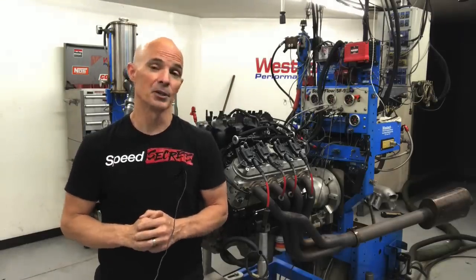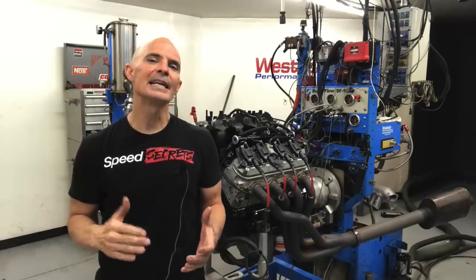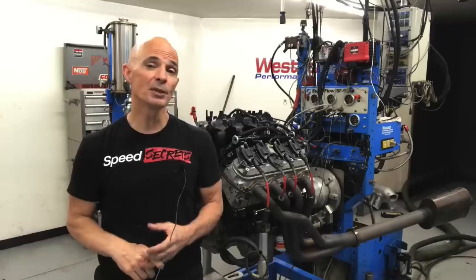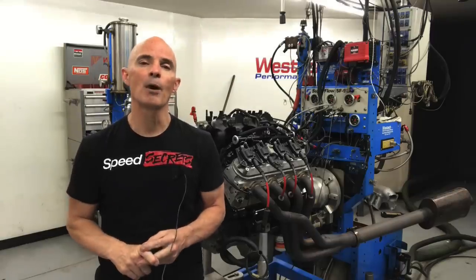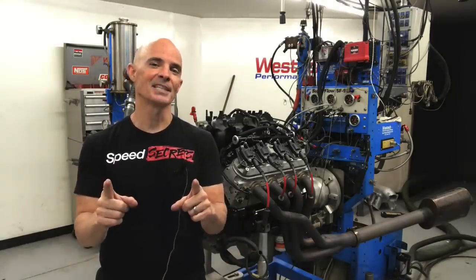In my opinion, if you got a street car, even a turbo 4.8 liter, I'd pick a smaller Stage 1 type cam. And the reason for that is a Stage 1 cam will allow you to get everything out of, say, a 1,000 horsepower turbo, like a 7875 or an S475. You can still get everything that turbo has to offer. But with a Stage 1 cam, you do it with better idle, better drivability, and more low speed power. So on a 4.8, I'd go smaller, but that's not what this test is about.